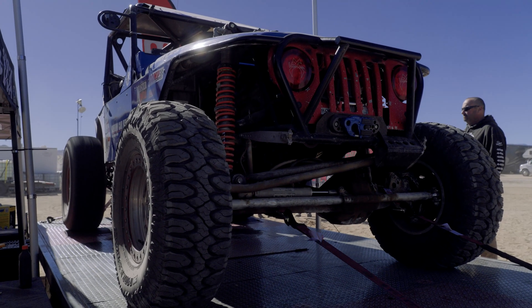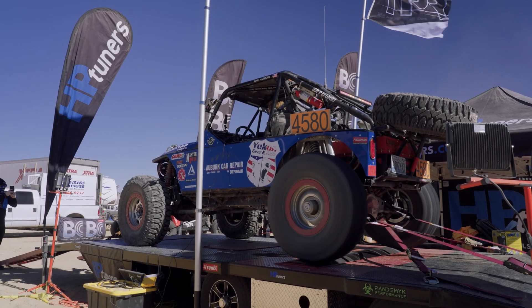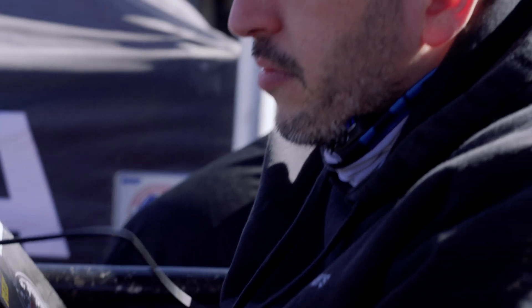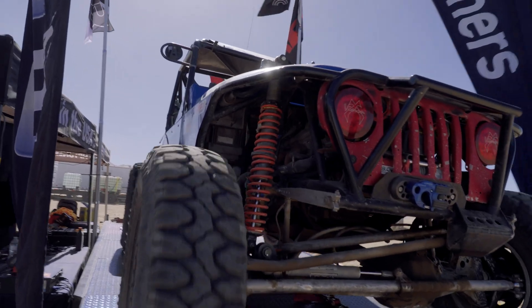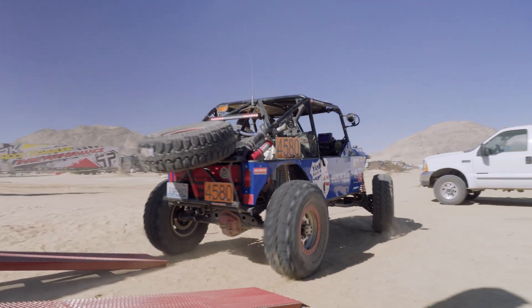Out here at Hammers it's not a flat-out horsepower race like Branson or Sturgis, but having good overall drivability when you're laying into the rocks — that little bit of finesse can definitely be the difference between the right line and the wrong line. Having these guys out here is a game changer. The VCM Scanner pulled data to see that it was lean going into power and rich coming out, so we added fuel to those areas and made the Jeep run the way it should. With the improvements we made, we should definitely help him get to the winner's circle.